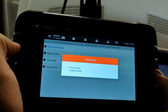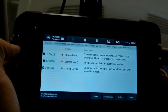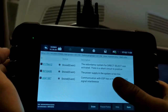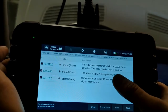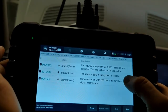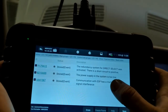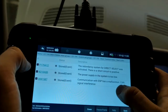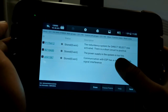If you cannot read codes at all from the ISM, that's an indication that the ISM is defective. In this case, you can see all these codes — they're stored codes, meaning an issue was detected in the past. There was a short circuit to positive, and the voltage of the vehicle is too low. A lot of times when battery voltage drops below 10 volts, the ISM module can struggle to power up and control the transmission — that's a common issue. You've also got a communication fault with ESP.